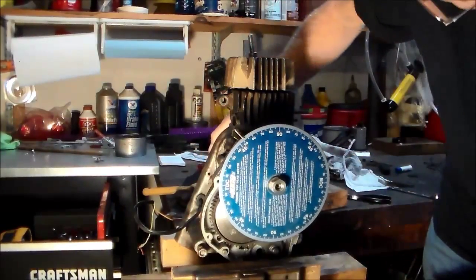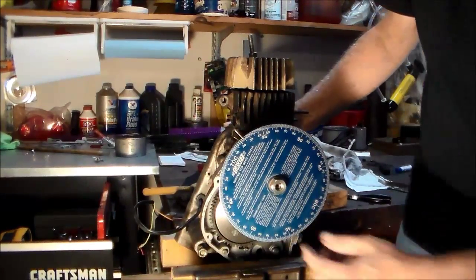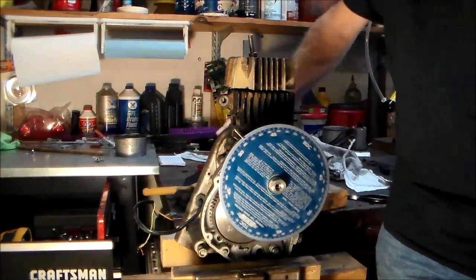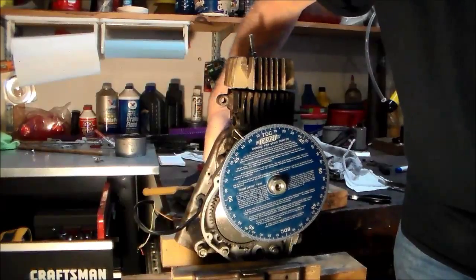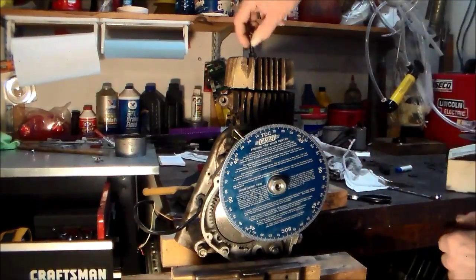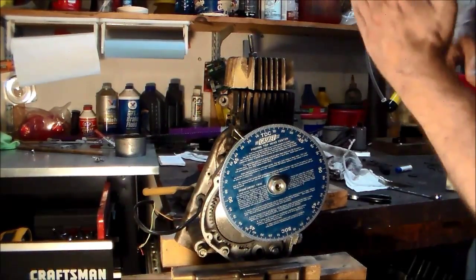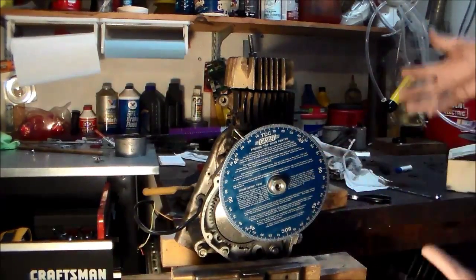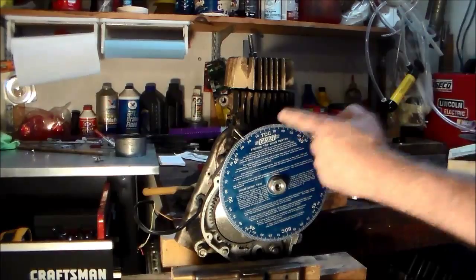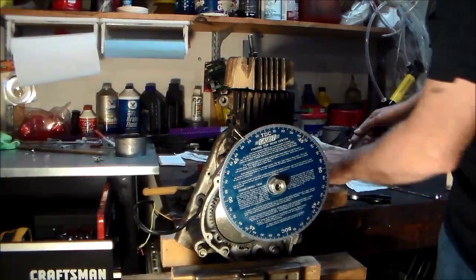And we got 23 — that's one degree different. I'm going to go to 24. Excuse my head there — I'm at 24. Go back the other way and 24. Now if my math serves me right, if I take the bolt out and go to top dead center, that has to be it. If I'm 24 this way and 24 that way, it has to be in the middle of that. So I'm going to snug this nut and double-check my numbers.